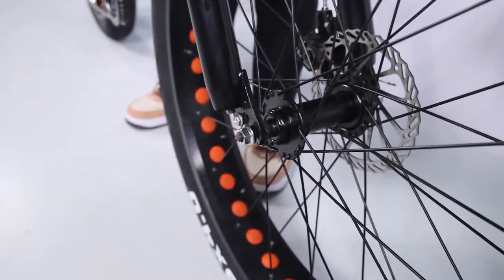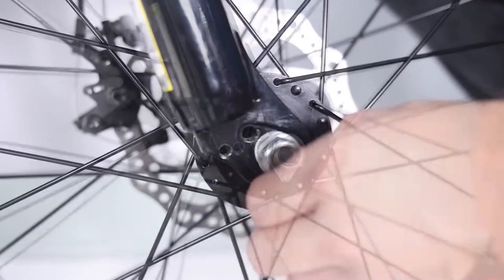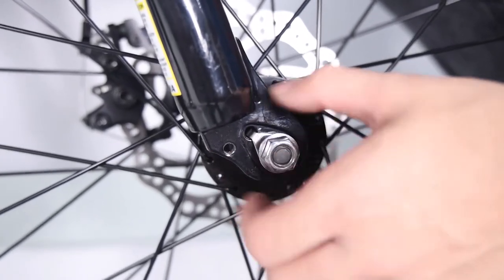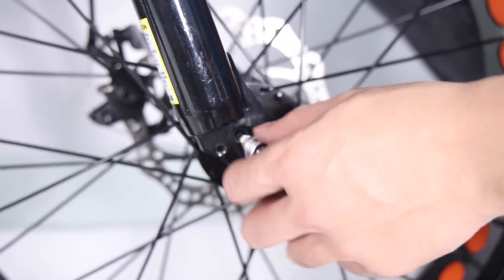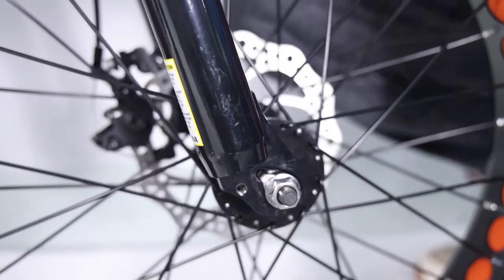The front rotor orientation should be to the left of the fork. After inserting the front axle onto the fork, you will need to line up the axle lock washers. These are the metal washers with a bent tab on one side, with the hole at each fork. These two special fork lock washers keep the wheel from falling off if the axle nuts ever loosen up.